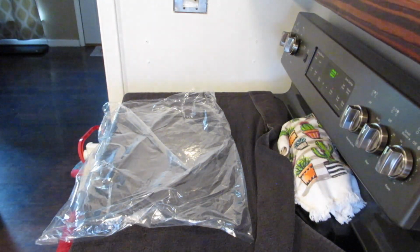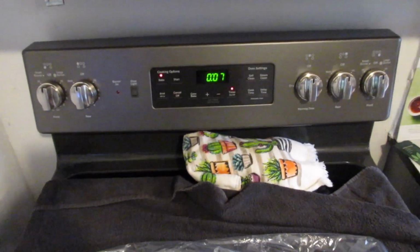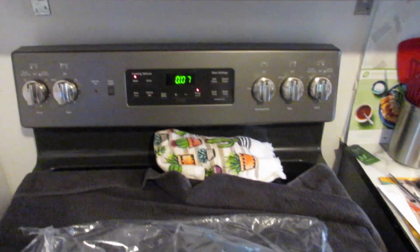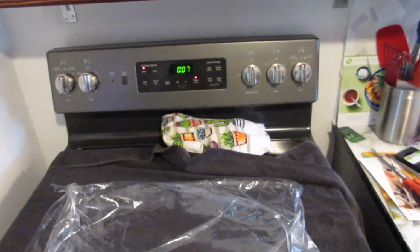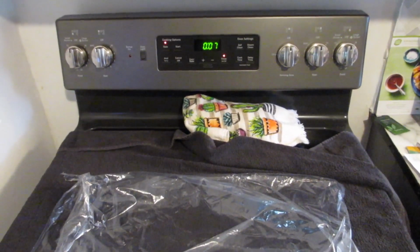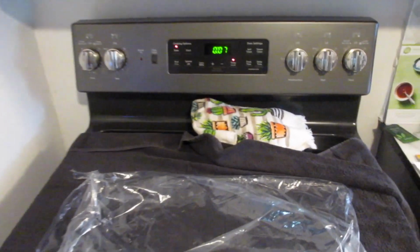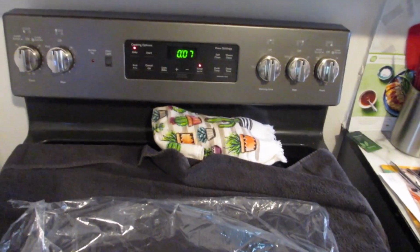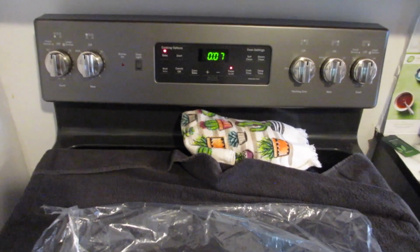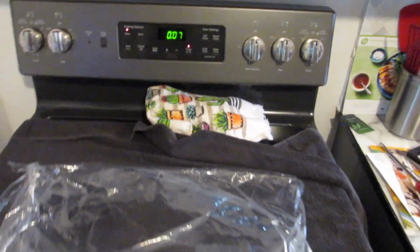So these headlights are butyl, they are not Permaseal, so they're going to be a lot easier to open. I'm starting at 225 for 7 minutes. I always start at 225 for 7 minutes as my baseline to test not only the glue, but the structure of the headlight. Because if you come across cheap headlights, you could actually melt the plastic before you would loosen up the Permaseal.